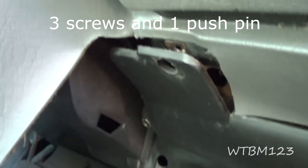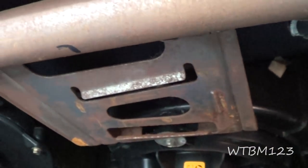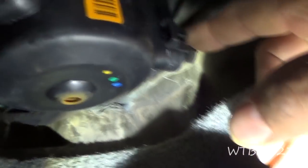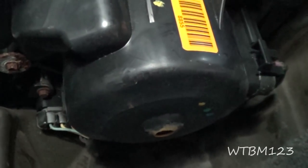There are two bolts to get this piece off. From further looking at it, I don't think the glove box does us much good. See how this is made? It fits right up into here — it's just a sliding thing, so we can push it off to the side. Here's the blower motor, and here are the two wires going into it that feed it. Back here in the back, you can see this group of wires and a couple of bolts — that's the resistor, and that's what changes your fan speeds. What I want to do is probe in here with it on and see if I have power here. If I have power there, I'm going to jumper the motor and see if the fan motor runs.